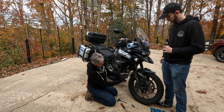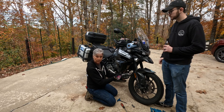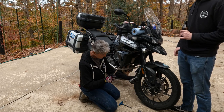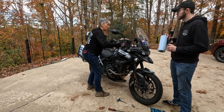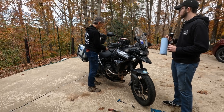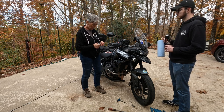You'll notice that the pistons are visible and the brake pads are pretty worn down. So what you're going to need to do before you put the new brake pads in — that are thicker because they've got the braking material on them — you're going to have to push back all of these pistons. So leave the old brake pads in and get your handy-dandy big-ass screwdriver, your big bass. But before you do this, you're going to loosen the cap on your brake reservoir. You want to make sure that it's level so that the brake fluid doesn't spill. And we need a teeny tiny screwdriver to open this. I always have a teeny tiny screwdriver with me. So for my brake reservoir, I need a teeny tiny little screwdriver, and most brake reservoirs do require teeny tiny little screwdrivers. My handy-dandy multi-tool here.